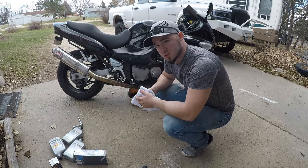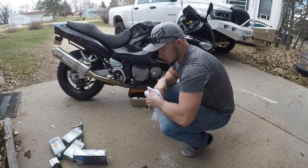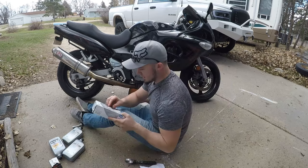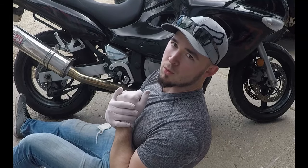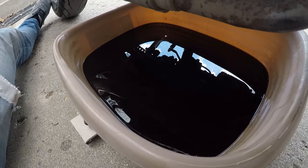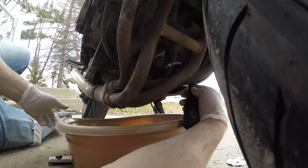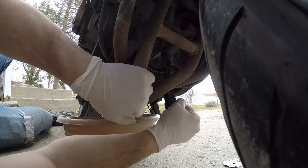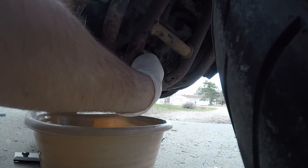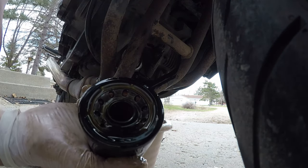The Katanas are oil/air cooled — there's no antifreeze in there, so there's a lot of oil. Make sure you give it plenty of time to drain out. Pop that filter off. I got gloves — doesn't even use them, what an idiot. I don't always wear gloves during an oil change, but when I do... Look how freaking dark that oil is. She was a dirty girl. There's the filter — we're going to go in between and get up there and take her out. Scoot this back just for a second to crack it loose, because most of the oil is drained out but there is still going to be some in the filter.